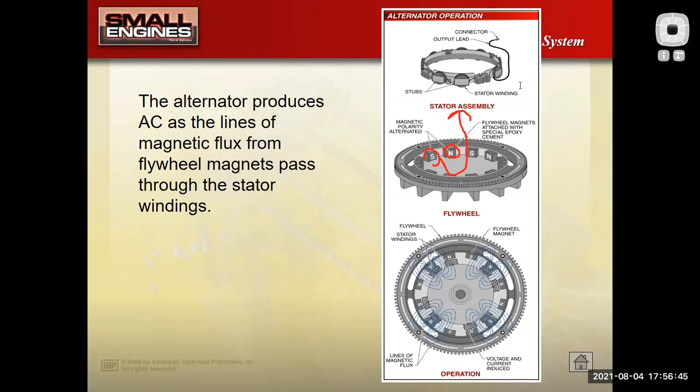On a car, we talk about the alternator. The alternator of my car is out. It's not charging my battery. Now, why do we call it an alternator? Well, it actually makes AC on the inside. So that's why it's an alternator. Way back when, we used generators, and those made DC.